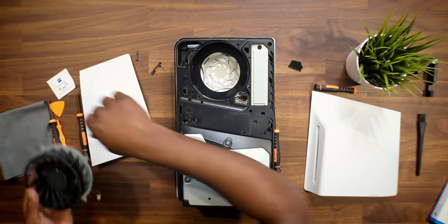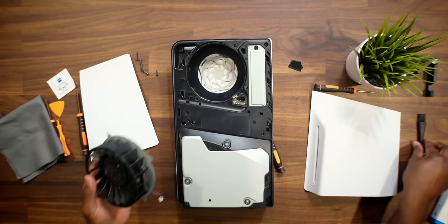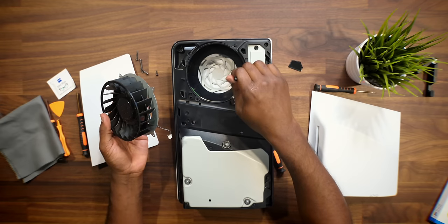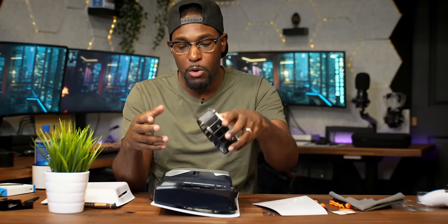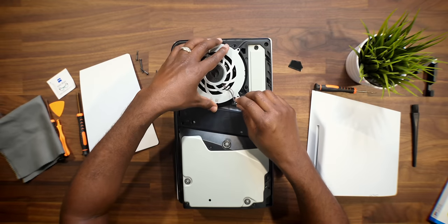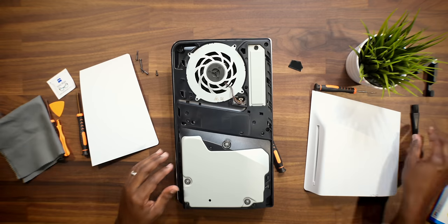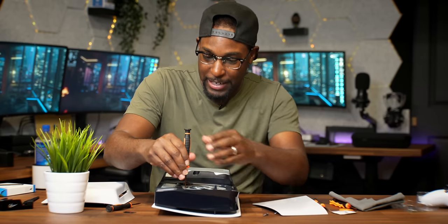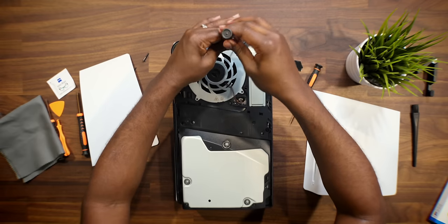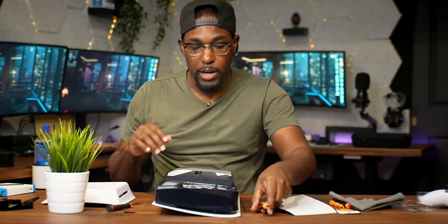You may need to actually unplug the cable to take the whole fan out and dust it off properly. I've only had this for a couple of days, so there's no dust yet. Inside the cavity, you can take your microfiber cloth and get in there to remove any dust, and use the brush to loosen any dirt stuck to the sides. To reinstall the fan, lay it flat, plug the cable back into the motherboard, and put the screws back in. Note: the long screw goes in the top-right corner, the short screw in the left corner, and the other two are the same size.